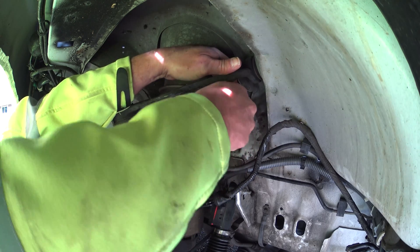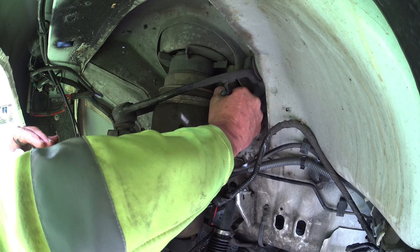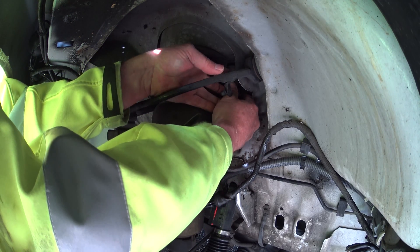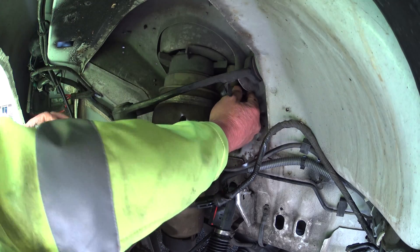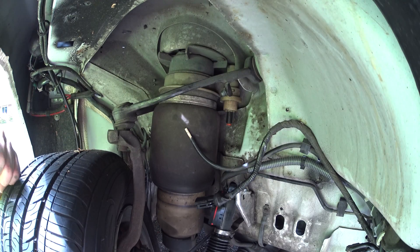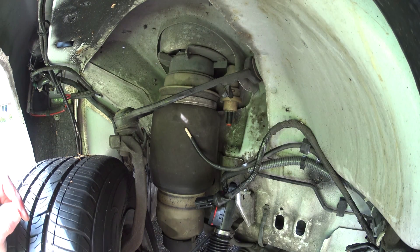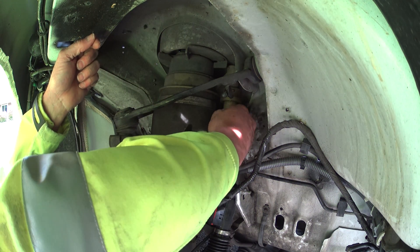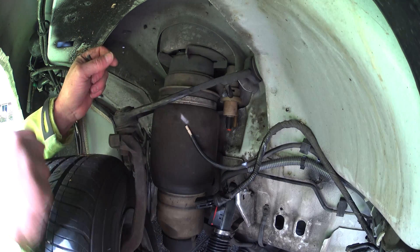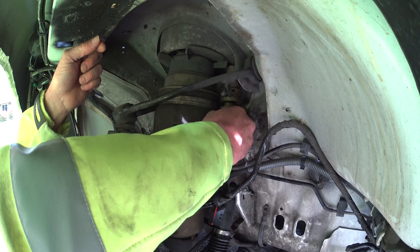The electrical solenoid has got a little clip up here to hold it in place. Once I get it going, it'll be simple. That's what keeps it from turning loose. Now I'm going to make sure my jack is tight - okay, it's picking up the wheel. I'm going to rotate it one click, and that's going to allow it to slide out. It's going to let the air out of the bag - you'll hear it. And then now that it's empty, go ahead and pull it all the way around and down it comes.